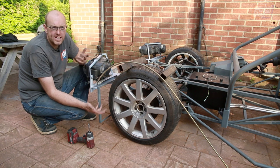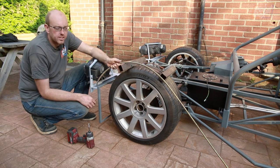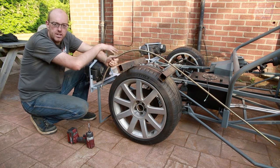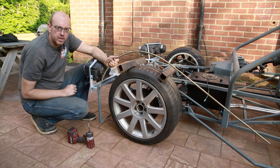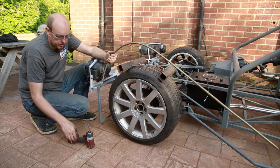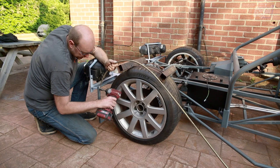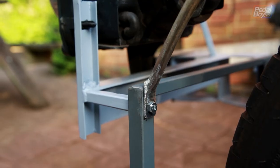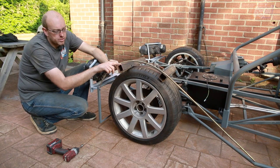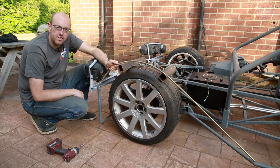Well, we've only got one more bit to do and now the sun's chosen to come out — a bit annoying, it could have done that a couple of days ago. We can't weld this on at both ends because the piece it attaches to here is where the radiator mounts off, and that whole frame comes away from the car, so this is going to be bolted in. I've just welded on this little flange which will go into the back of the headlight mounting screw, so we've got one screw that does all those fixings. That will weld onto the floor at that end — I'll tack that in, and I've used the same spacers to make sure the arc works all the way around. I'll get the other side done as well and then that's us done.